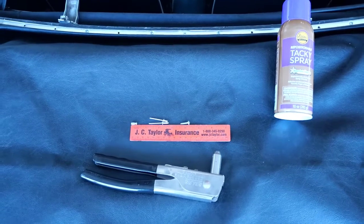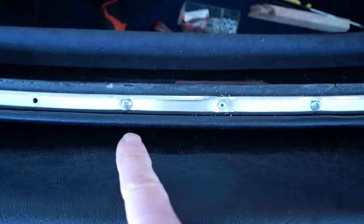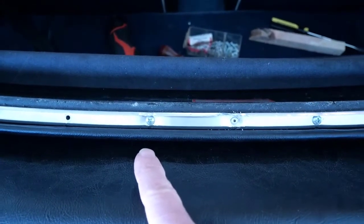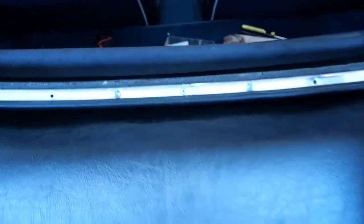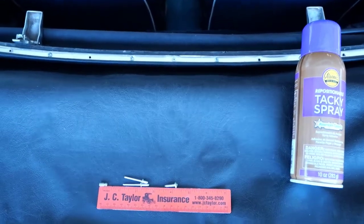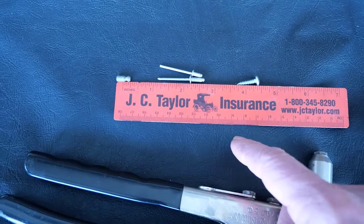I've made progress on positioning the convertible top with the new holes. I went ahead and punched new holes into the head rail and then attached the head rail with just sheet metal screws to try it out for positioning — it's easier to remove those if I want to adjust anything. I put everything in with my new holes on the fabric, extended about three-eighths of an inch, then laid everything in. I used contact cement, gave it five minutes to dry, then applied everything with a standard sheet metal screw. But when I put this together for real, I'm going to use rivets.